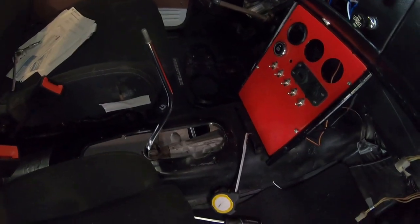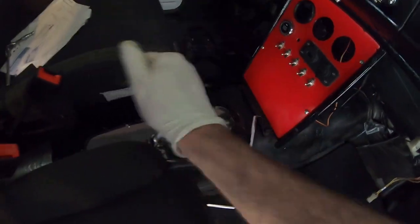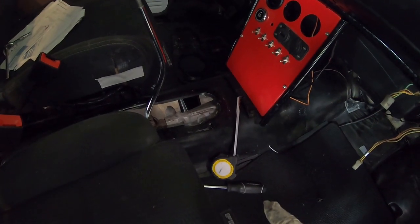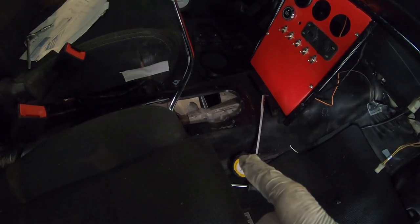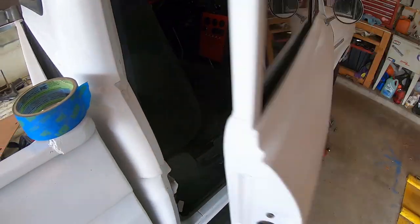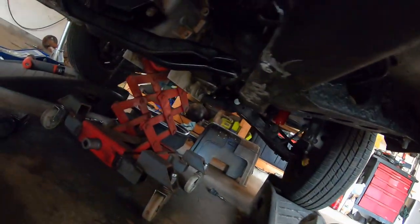Okay, I got the 5-speed installed on the motor. Got the shifter in. I noticed there's an issue though. When you go from 5th to reverse, there's no lockout, so it's a detent ball or something stuck. Anyways, tranny's bolted on the engine. I'm trying to figure out the right position. Right now I got 6 degrees. I can't go up any higher because the tranny hits the body. I don't know what the trick is to get these trannies to fit. The engine's at 2.7. Tranny I think is at 6. Other than that, it's right in the center.